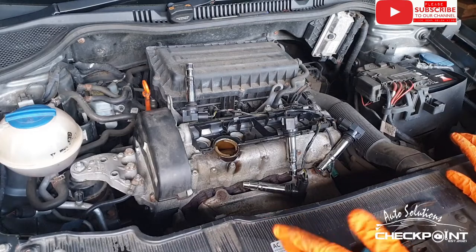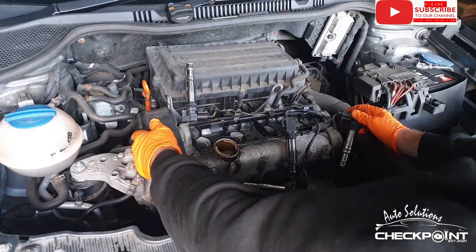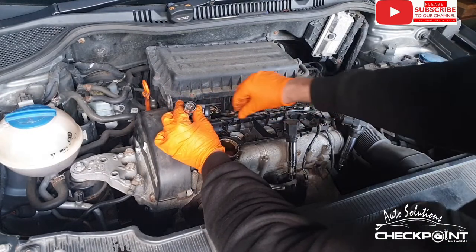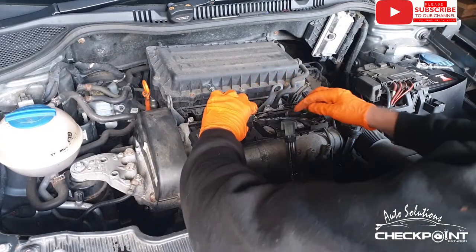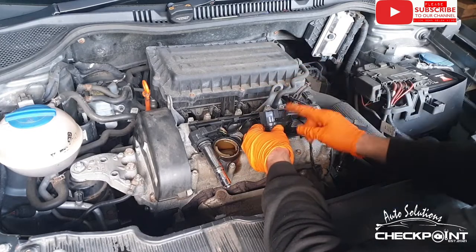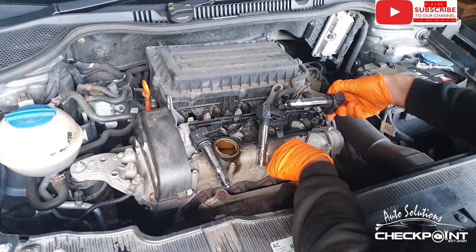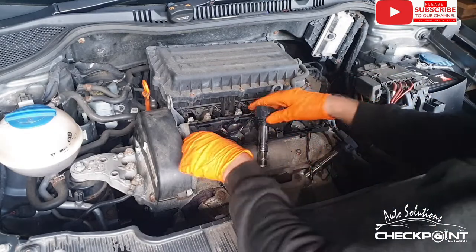Okay, obviously there's less chance of you mixing these up. I always go number one from the cam belt. So number one is the furthest cable, so that's a longer cable. Right, notice number three, the cable isn't as long. So that's number three. And number two, you can't go wrong with this. Number two is the shorter cable. And then you get the really, really short cable with this coil pack.